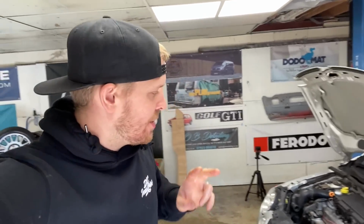Unfortunately, we were doing a bit of looking and digging around the engine the other day, and when it was cold, there was a bit of smoke on startup, so we decided to compression test it, and cylinder 2 is low compression. I think we're supposed to have about 150 on each cylinder, and cylinder 2 was at about, I think, 90, and then we managed to get it up to 100. So the engine is a little bit poorly.